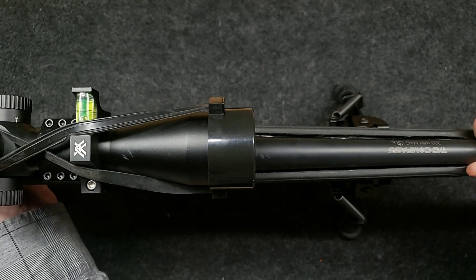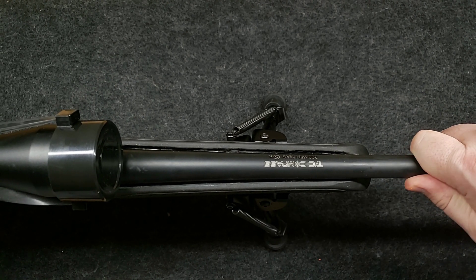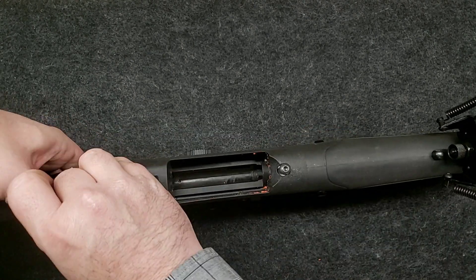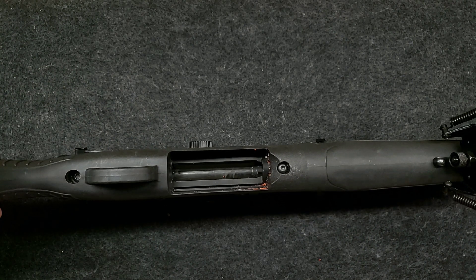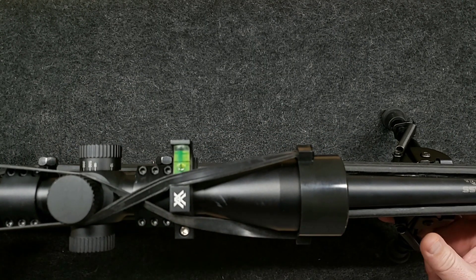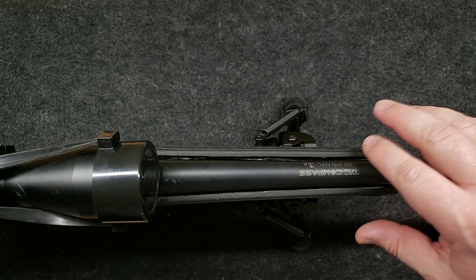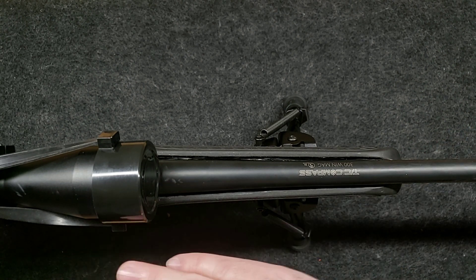The other thing — if you remember when we pulled this forward and back, we could hear an audible clicking. That is gone. It doesn't move at all, and no receiver action screws in. I'm going to torque this down real quick. Front we're tightened down to 45 inch pounds. So this is locked into the receiver, no movement front and back. You remember when we just put in the stock stiffener in the front and hadn't bedded this yet — I had done a video where I moved the barrel and you could see it was moving. This is what I want to test again — did the bedding lock this down any further?